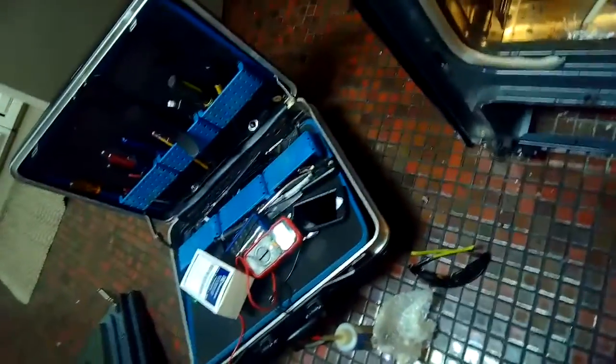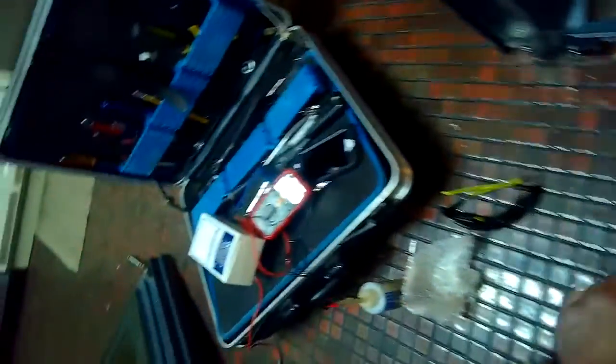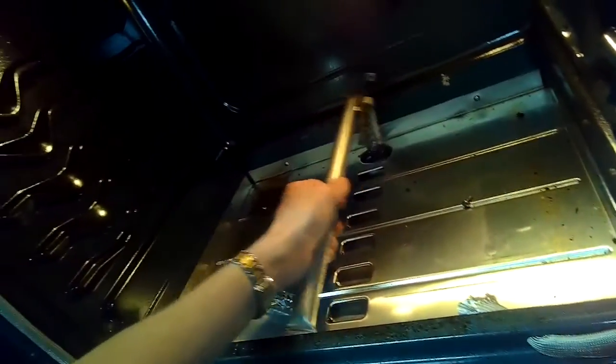And now it's pretty easy to take the tube out, but there's a little wire underneath that we have to disconnect. So we've pulled out the broiler drawer, the bottom drawer, so we can get to that little wire. And you just go down on your hands and knees and peer in there, and you'll see a little wire connected with a spade connector, and just grab that. And again, make sure you have the power off, and you're going to pull that down, and that'll disconnect it, and then you can pull the whole assembly out.